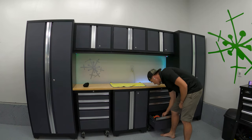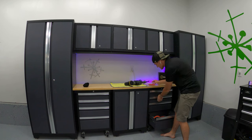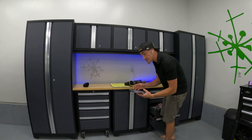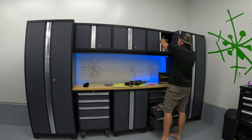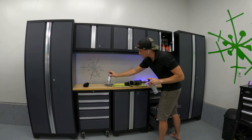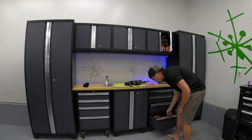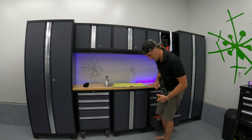Paint corrected. So we're going to start with the 5-inch pad. And this is Billet Silver Metallic. I've done this paint before, paint correcting. We're gonna use Meguiar's cutting discs for the compounding stage. And then, still doing that, we use CarPro Ultra Cut for the compound itself. I'm gonna change this head over really quick. Let me change this backing plate over really quick.